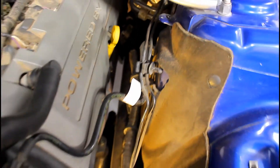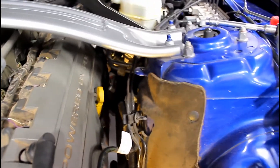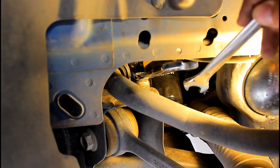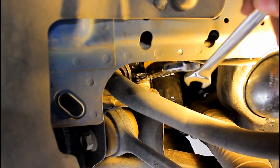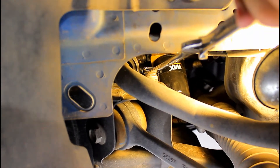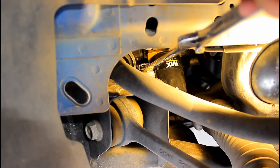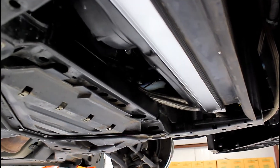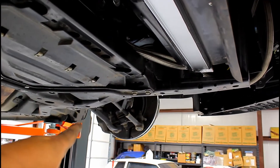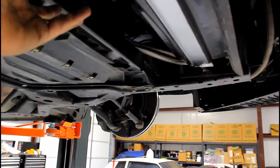To give me a little more flexibility I removed the brake line clip from the strut tower. On the driver's side the rear bolt is sort of shrouded by the alternator, so you're gonna have to use a box wrench with some leverage to break it loose, then use an 18 millimeter box ratcheting wrench to take it out the rest of the way. Easiest way to get it out is to remove your belly pan so one person can wiggle it out from one side while another keeps it from hooking on everything.